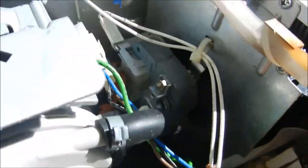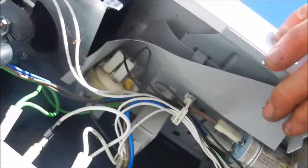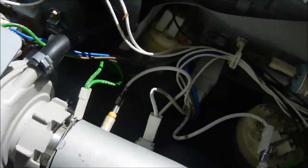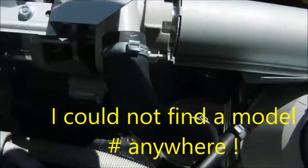Here's the pressure switch — this pressure switch is probably going to be the culprit right here. This is the water level. What I'm going to do is Google that. And here's another pressure switch right there, so looks like we've got two pressure switches here. I'm going to have to Google this one — I've never seen one like this before. Other than that, it probably works fine. It's just that it fills with water and apparently keeps filling, and that's the problem with this one.